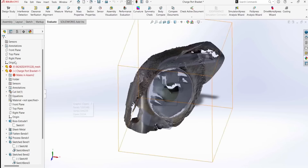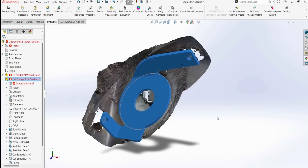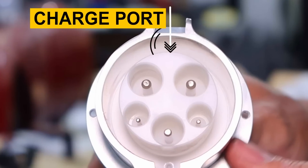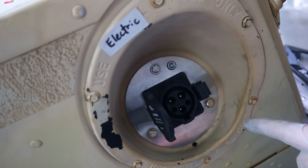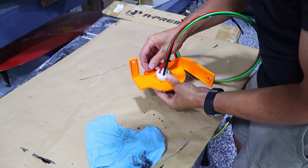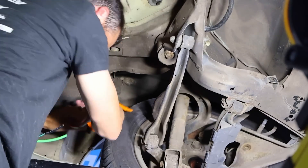Now that we have the scan, you can see it's really good quality. In CAD I put circles over the parts that are key — where we're going to put fasteners, and in this case the opening — and that helps me with the design. Here's the design I came up with. We put it into the slicer and make a 3D printed part. This is the AmpReVolt charge port — it's actually made from aluminum. Almost all the ones you see are plastic and don't look super high quality, so this metal one will work perfect right in the gas cap location. Here's the 3D printed part — it turned out okay. We're going to see if it fits and test it in the car to see if we need to make some modifications.